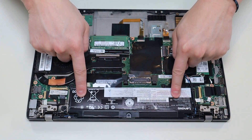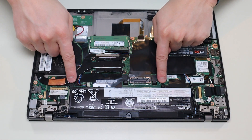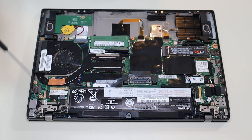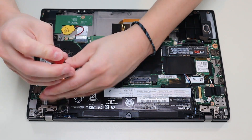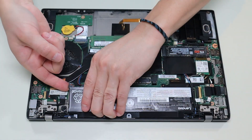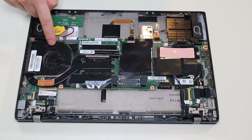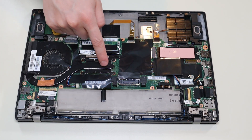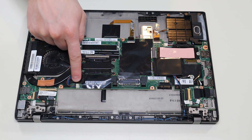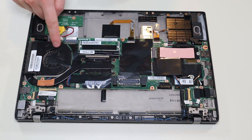This second battery is very similar. It's held in by these two clips, these two screws here, and it plugs into the motherboard there. I'll take these screws out, lift it up from this plug and slide it out from those clips. So this is your fan here and your heat sink assembly that runs over your CPU over to this vent. The fan plugs into the motherboard right there and the heat sink screws down with these four screws here.